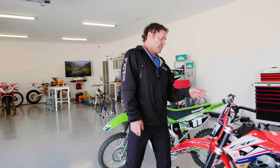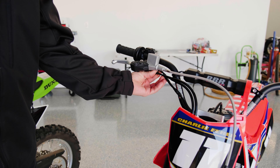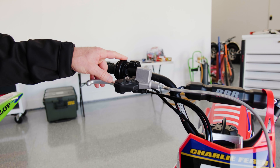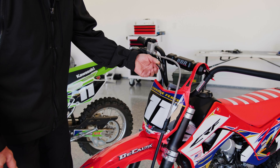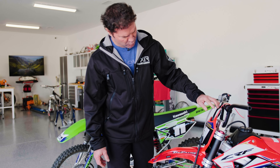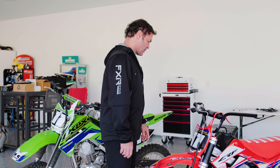You do need to order a longer cable for the front. If you look here, we had to flip this upside down — I think this is with their longer cables for the throttle cables — and we still had to flip it upside down for the 910 bars. Hopefully they'll come up with even longer throttle cables to accept the 910 bars. This is the BBR part number for the longer ones to work with the front forks. If you call BBR, they're great — they'll tell you which ones to run.